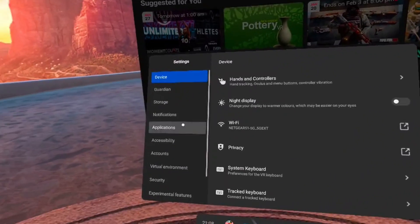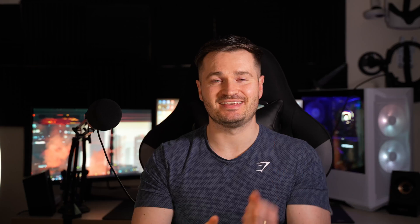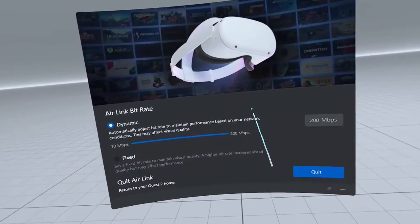To use Air Link, make sure the Oculus app is open on your PC. Go to settings and enable Air Link — note it will turn itself off after 48 hours of non-use so you may need to re-enable it. Then on your Quest 2, go to experimental features and turn on Air Link. From the home page at the bottom left, click to enable Air Link and it will connect your Quest 2 to the PC. There is only one setting to play with: bitrate. Lower bitrate means worse visuals but lower lag. Find a balance — I nearly maxed it out but pulled it back slightly to allow some breathing room.